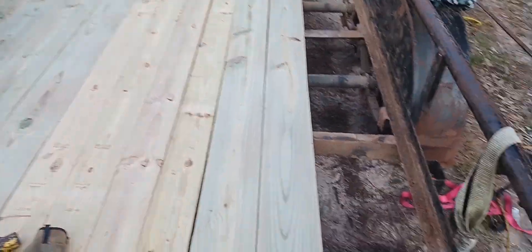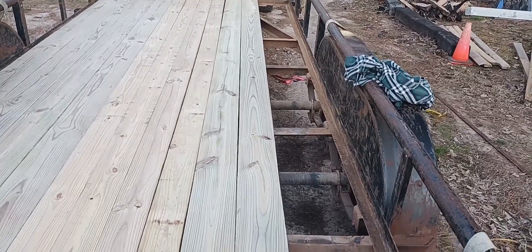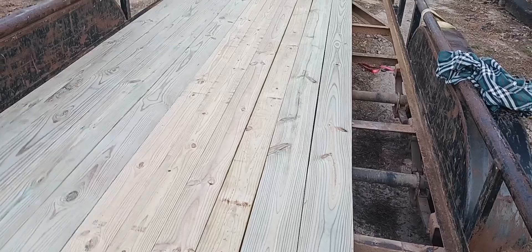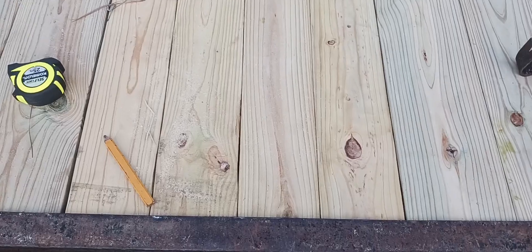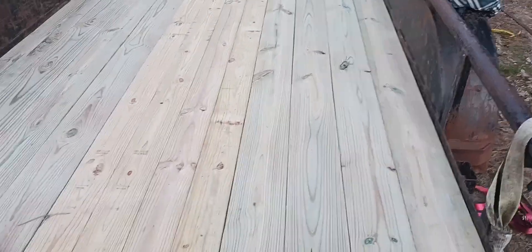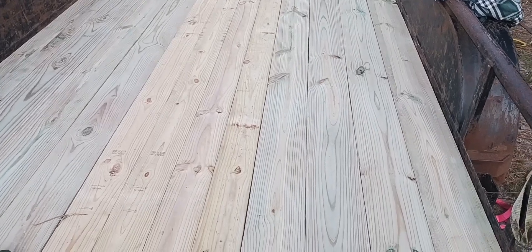Been working here — it doesn't take long. Just throw a board up, cut it off to the length it needs to be, and drop it in. Pull it to the front, stick it under the lip in the back, and bump them in tight. I'm cutting these so they fit a little snug. They're all in there and they all fit perfect. There's a kind of math to this — there are four two-by-eights, then four two-by-sixes, then four more two-by-eights. That's planed, treated lumber, and the math just comes out right doing it that way.